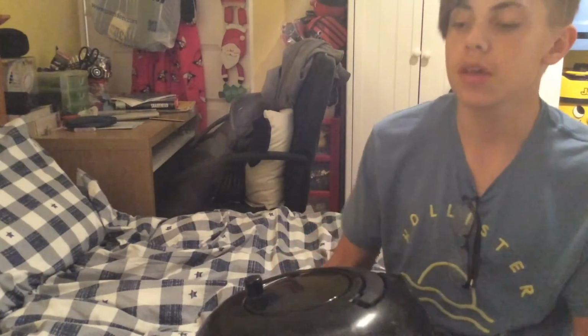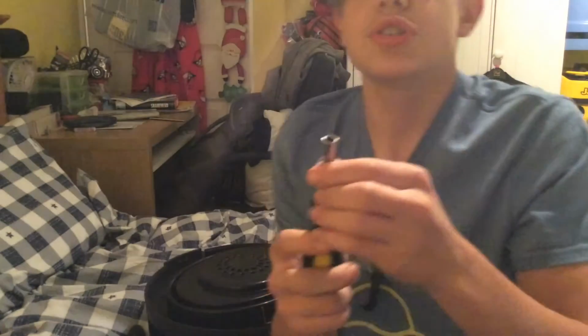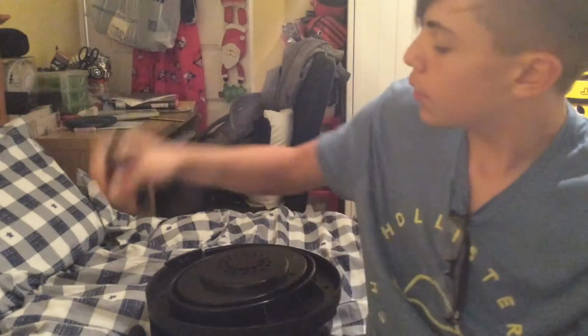Basically, if this is on the tub, you just release the latches and lift this off. Underneath here, there are 7 screws. You'll need a Phillips screwdriver for this, and also one of these, a standard screwdriver bit holder that holds these kinds of bits. They just clip in there. Depends, but that's the only thing we'll need. We may need a long nose pair of small pliers just to pull the spade connectors off, but normally you can do those by hand.